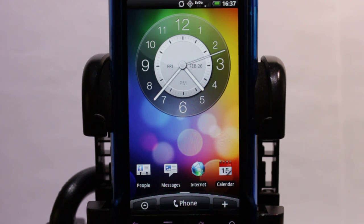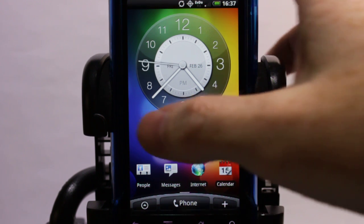Live wallpaper seemed to slow it down a bit, and the Nexus One doesn't work, so we're going to play around with using some of the updates that have come out for other ROMs. I'm not too sure that SAT GPS is working. A-GPS does look to be working, and at the moment Wi-Fi and Bluetooth are down, and we're having a few problems with the phone, namely incoming calls. I think it has to do with the PRI and it registering on the network — not positive, we're still playing with that — but otherwise it's fairly stable.